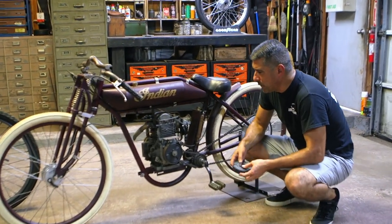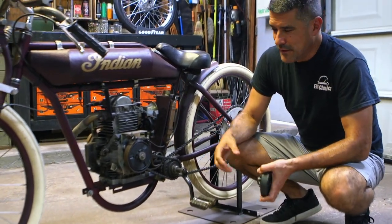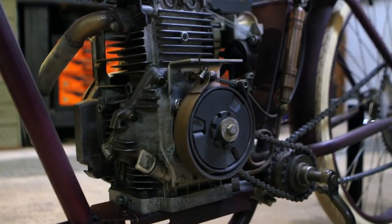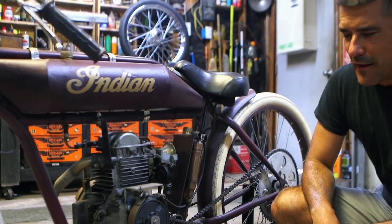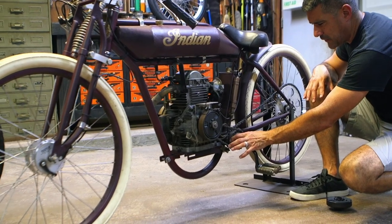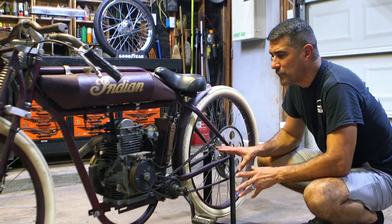On the drive side of this particular bike, we went with a centrifugal force clutch — the kind you see on go-karts and mini bikes. Very simple to operate: you just gas it up and it goes. On this one we have a band brake as an additional safety feature, because my son rides this bike a lot and I need to make sure he can slow down. Same type of setup: 10 teeth on the front, the middle is about a 20 or 24 tooth but we'll step that up to 29 when we convert it, and the back is a 64 tooth.